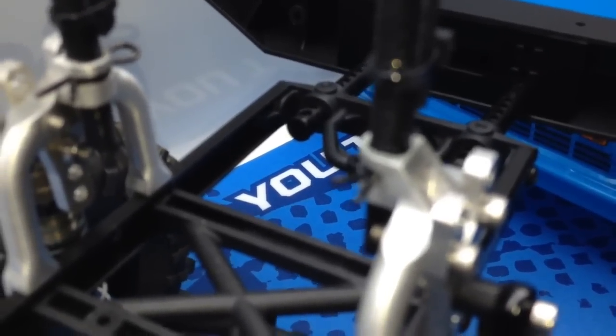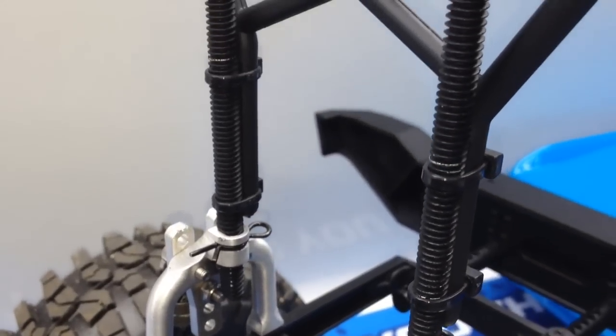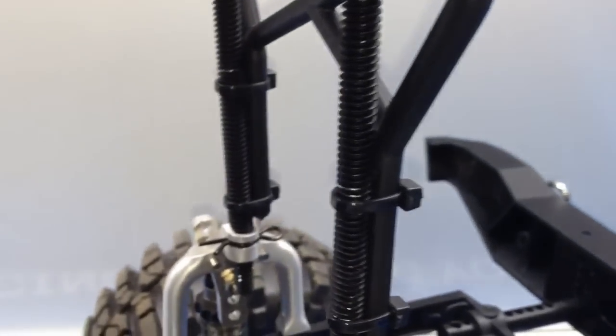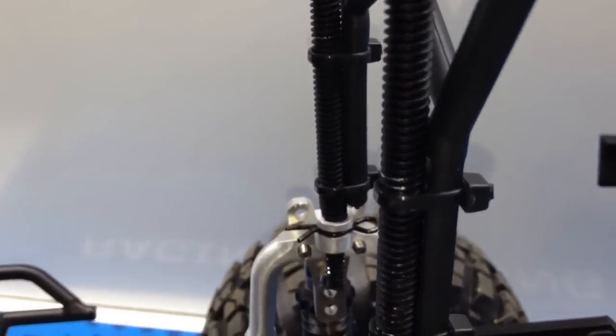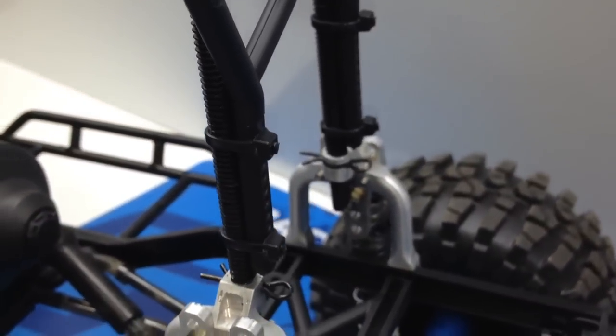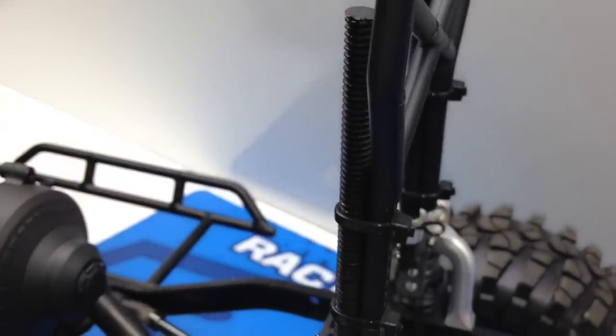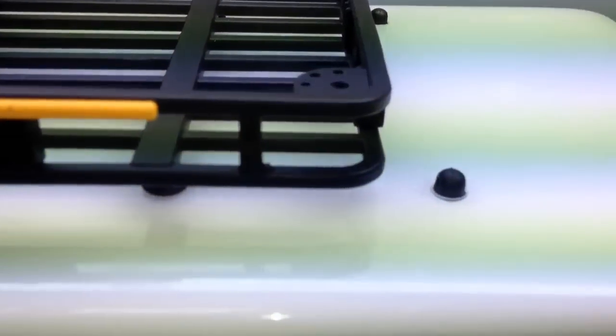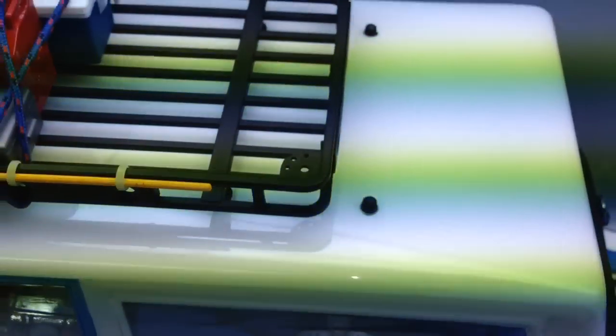I used the stock little body pins in there — just a small hole and everything's good. I left the threaded rod pretty high since I wasn't sure how high I needed to go, so when I zip tied the body mount on there it has plenty of room to raise or lower if needed. The other thing that really helped was that the body mount is set back somewhat by mounting onto the threaded rod, which worked out well when I put on my roof rack, since I didn't realize it would land right where those body mounts were going to be.